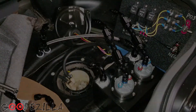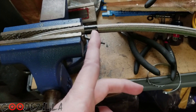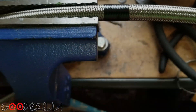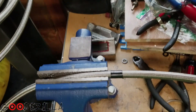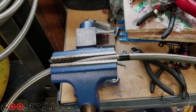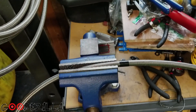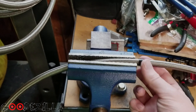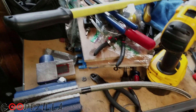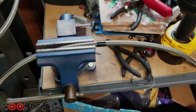I'm going to show you how I make these lines. I've got my dash six hose here. I made a mark and put a piece of tape around it halfway. Then I'm going to use my big cutters here to cut it in one quick motion. You can also use a cut-off disc, but that puts shavings in there, so I just like using this. I've had luck with it so far. So I'm just going to cut here, then we'll go to the next step.